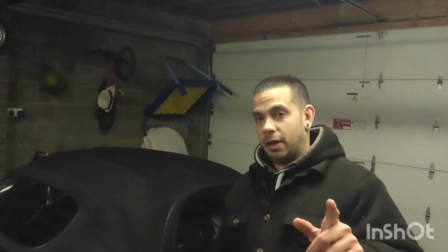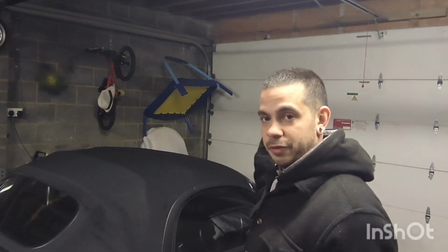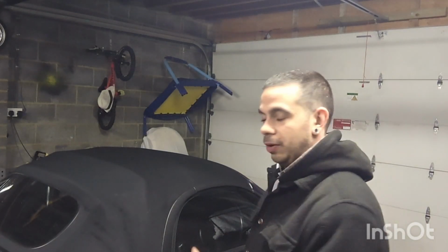When you go to lock the car, the first time after doing this, so it's quite normal, you get in, start the car, absolutely no problem, off you go. You'll go to button lock your car when you get to where you're going. The car will not lock, it will unlock because it hasn't been unlocked on the key. So if you have that happen, just pull your door handle when you think you've locked the car, check you've actually done it.